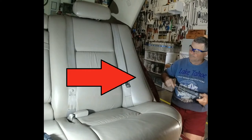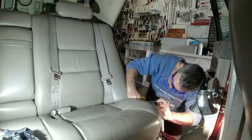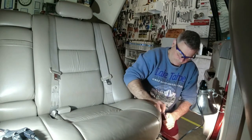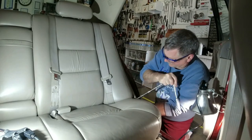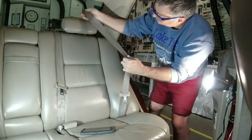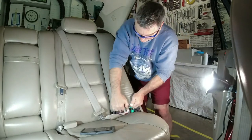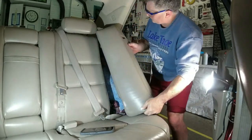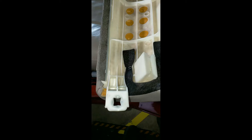After running along the door, the cable runs next to the back seat then up this side wall. To gain access we need to remove the side cushion. It's held in by one 12 millimeter bolt and is very easily removed with a very long extension on your ratchet. Now this part's really important: push upward on the cushion. If you pull it forward or wiggle it too much you run the risk of breaking the plastic clip that holds the top of the cushion in place. You have to go up about an inch to an inch and a half for that clip to clear.